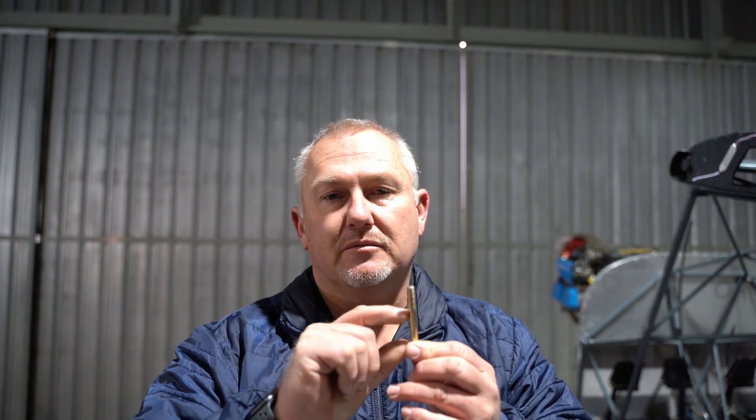Because this was a homebuilt project that I'm completing, I'm replacing all the bolts on the wing with new ones. We need to measure the bolts and cut them a little bit shorter. You want to make sure the load-bearing part is on the shank of the bolt. The bolt should be just long enough so the shank is in the load-bearing area — fit a washer at the bottom where the nylock nut will sit, not under the bolt head since this part isn't turning.